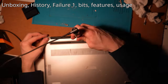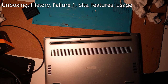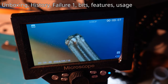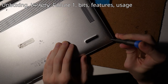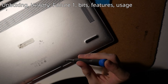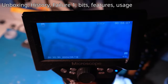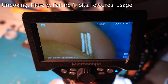As my first victim, I tried to unscrew a Huawei laptop's back cover using the small torx bit. After doing only five screws, the end somehow stripped. How is that even possible? It might be user error — I don't remember which mode I was on, but it might have been strength 5, which is maybe a bit too strong. I tried testing the same bit with the iFixit handle but it only seemed to get worse when I applied more pressure. I'm going to say the bit is just poor quality. This is the iFixit tip — I've used it a million times and it still looks like new.